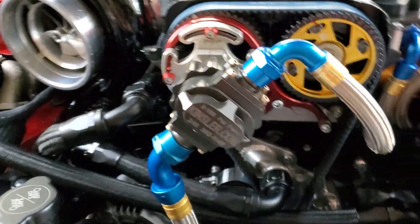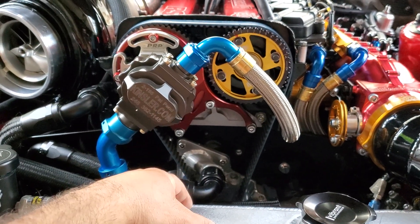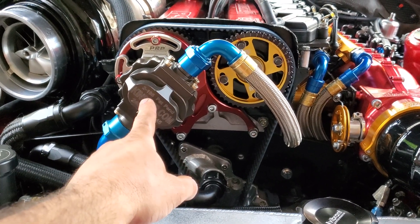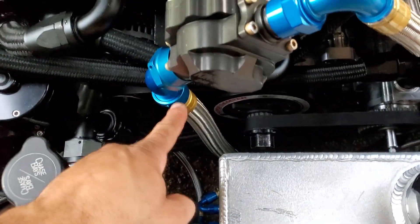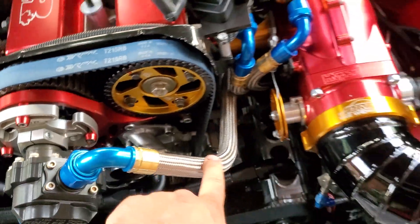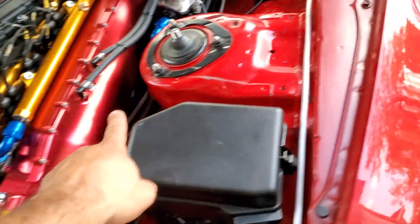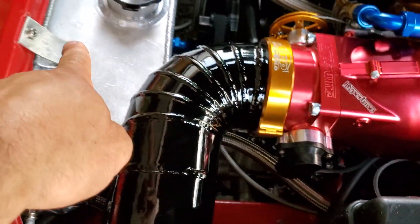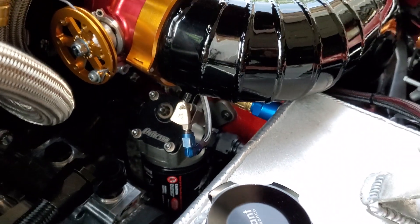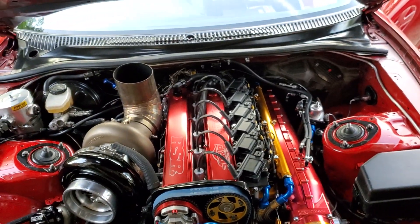For the fuel system, it's BMRS lines, Platinum Racing Products fuel system, and a Kinsler 13 GPM pump - 13 gallons per minute, which is good to support 2,500 horsepower. There's an AN16 line coming from the fuel tank, an AN12 going out that splits into two at the back, with return outlets to the regulator on either side and back to the tank. We also have a little shot of nitrous - a 200 shot, mostly for spool, so I don't think I'll be using it up top.